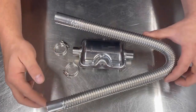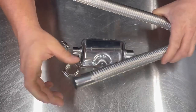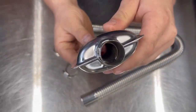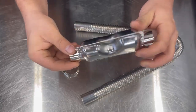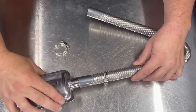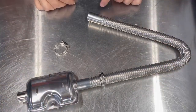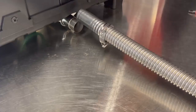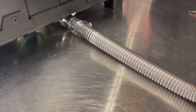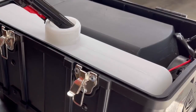To set up the heater, we'll take the metal tube that comes in the package with the silencer — not much of a silencer if you can see right through it, but it's a muffler if you will. There are two clamps. We'll go ahead and add a clamp, install the muffler into the tube, and install the other side of the tube to the exhaust port of the diesel heater. Then I'll add about a half a gallon of diesel.